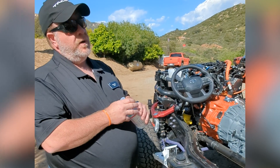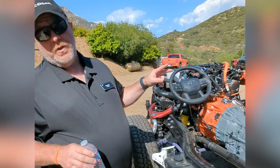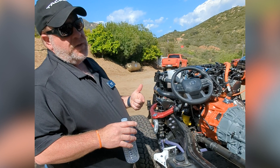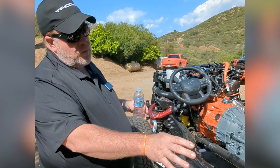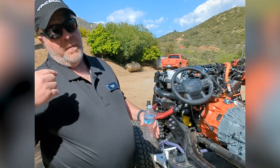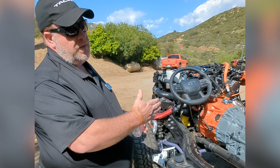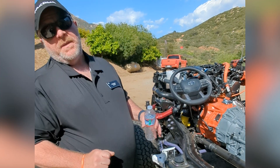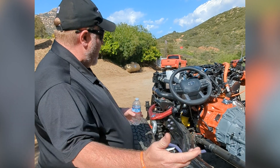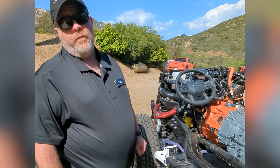This is a little bit different from our THS — Toyota Hybrid System — which uses a two-motor generator system. That's very much different. That is a slightly larger motor application and usually a little bit larger battery, and those are really focused on assisting drive force across the entire drive spectrum as an efficiency-based hybrid. So this is a bit of a balance for the truck market in our first introduction, where we've gone with this performance-based approach.